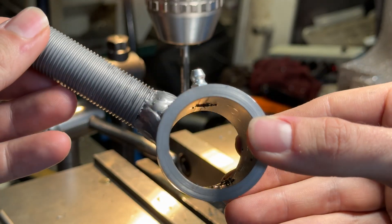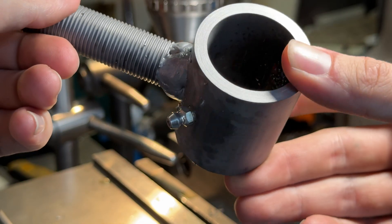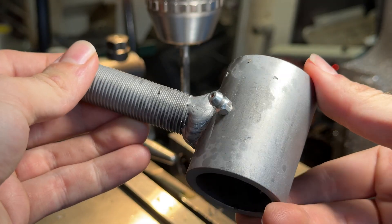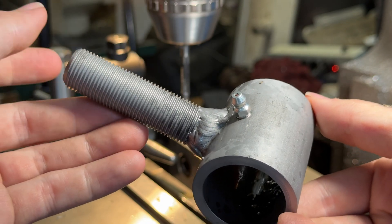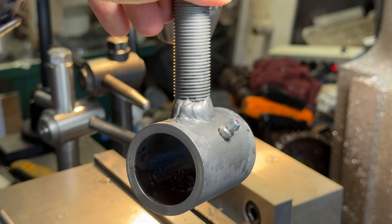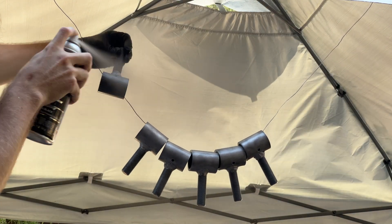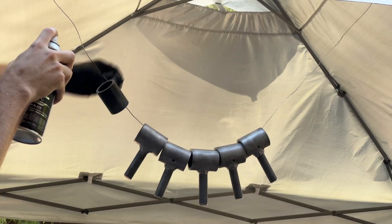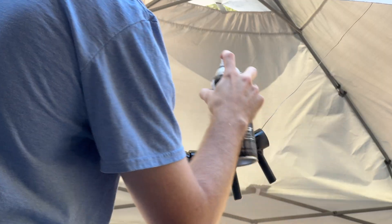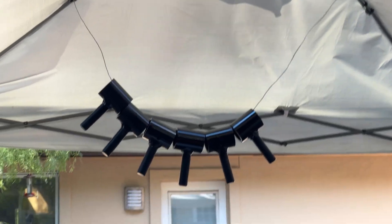Here you go guys — we'll take off the little bit of splatter on there, clean them all up, paint them satin black. We've got three types of bushings to push in and a center sleeve, and that will be for the outer position on the car with the spherical joint on the inside. With the holes for the fittings drilled and tapped, I can now paint them all after cleaning them with acrylic cleaner. This is a really bad way to hang them and I should have done more setup, but it works — I did another couple of coats later anyway.